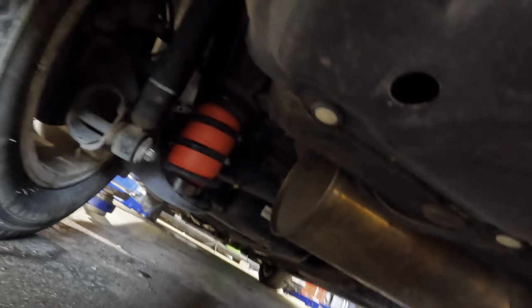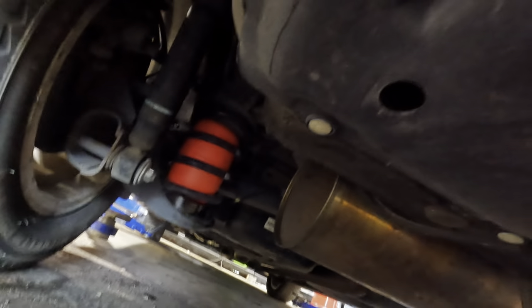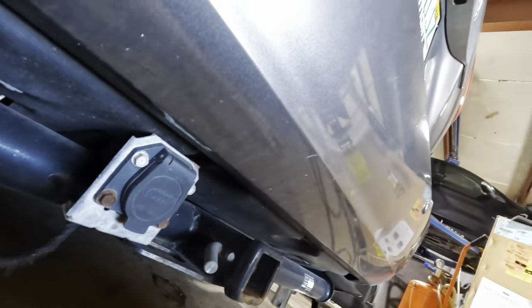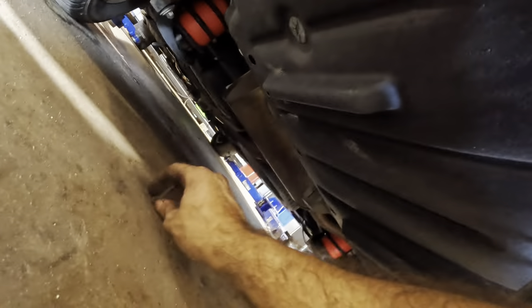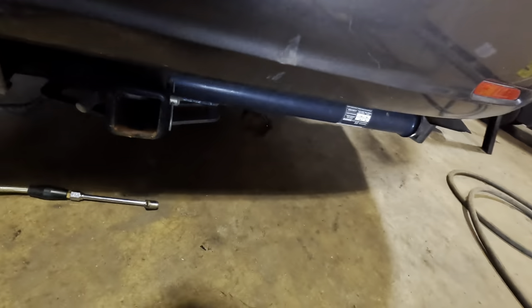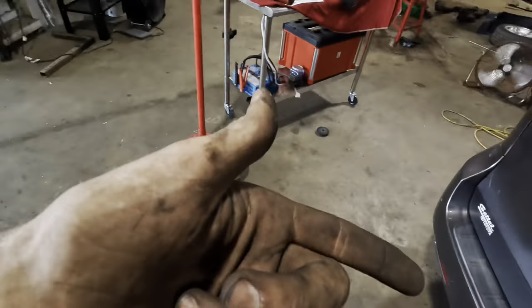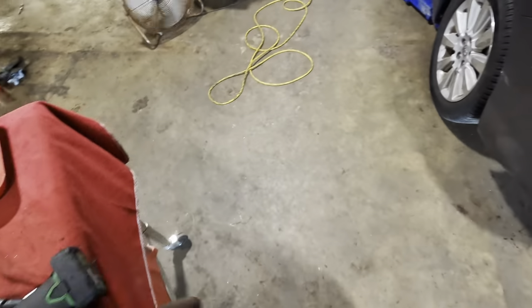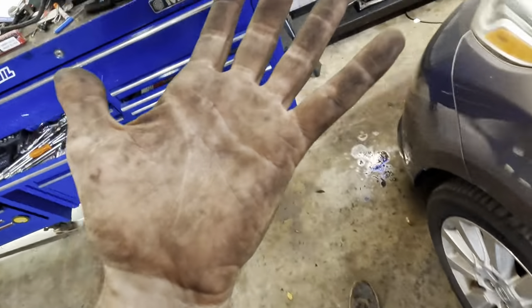Taking a look at the actual bags, you can see they expanded — they're slightly inflated, and that is providing a little bit of extra lift and support for those springs. That way it'll take the sag out of the tongue weight when you add a trailer. I really lucked out and did not have to install this system on a virgin vehicle — the plumbing and everything was already connected, so I didn't have to install extra stuff. That was a win for me and a win for the customer because I didn't have to charge them as much money.